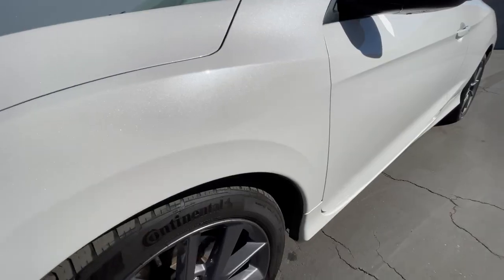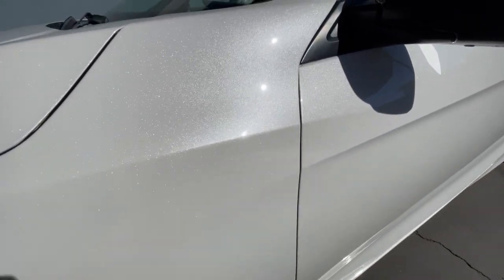Welcome back to my channel everybody. Today we're gonna be spraying this Honda Civic behind me — it's a three-stage pearl white metallic. First thing we're gonna do before I start prepping the quarters is spray a black primer guide coat, unmask it, wash the car because it's pretty dirty, then prep the quarter, prep the door, buff the fender, and we have a new bumper. Then we're gonna blend into the hood and it should come out looking good.